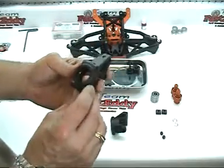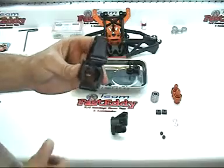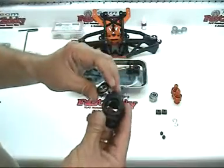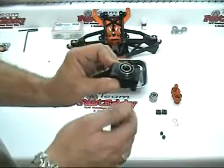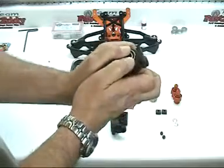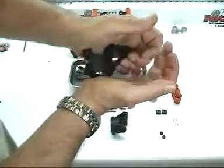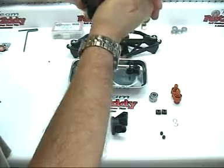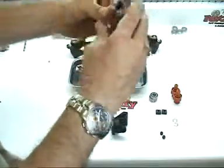The first part we're going to do is insert the bearings into the front wheel hub carrier. If you look on the front there's an opening for one, and on the back there's an opening for another. Before we use the bearing press, I like to see if I can get them in by hand — they're a tight fit. I'm going to set the bearing on there and evenly distribute weight with my fingers to see if I can walk the bearing in. Doing stuff in front of the camera is a little difficult — you have to get yourself into unnatural angles. These are not going in by hand.